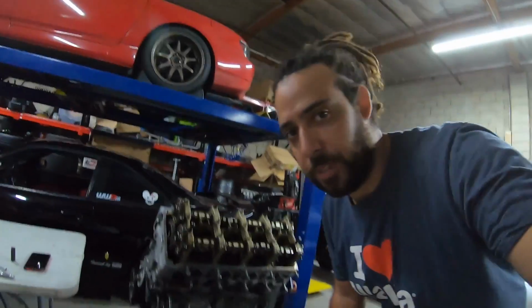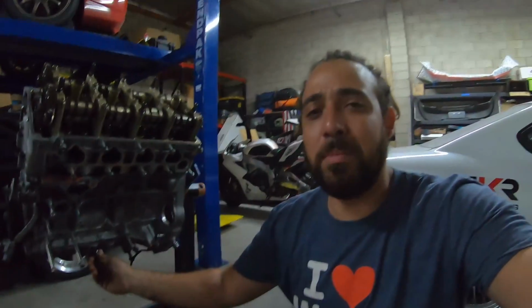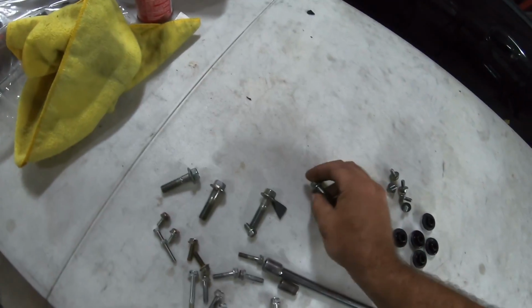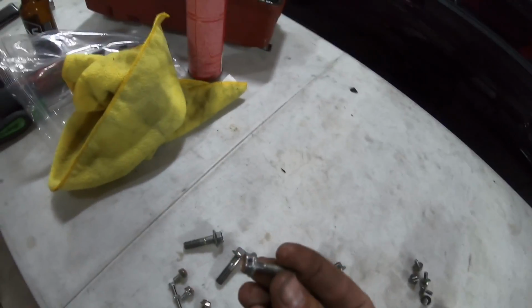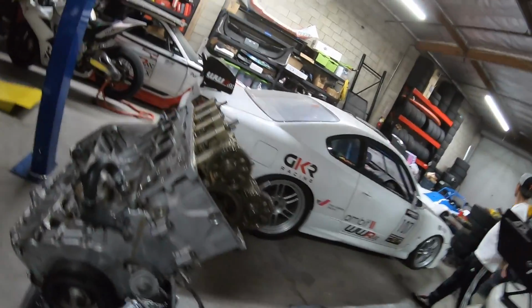A little tip I wanted to show you. As you take apart the motor, there's gonna be a whole bunch of bolts you gotta keep track of. One of the hardest things about taking apart a motor is figuring out where all the stuff goes when you put it back together. To make my life a little bit simpler, number all the bolts. See, that one's number 15. Down here we got number 10. So by numbering all the bolts, it should be a lot easier to keep track of where they go and put it back together. All right guys, motor's fully torn down.